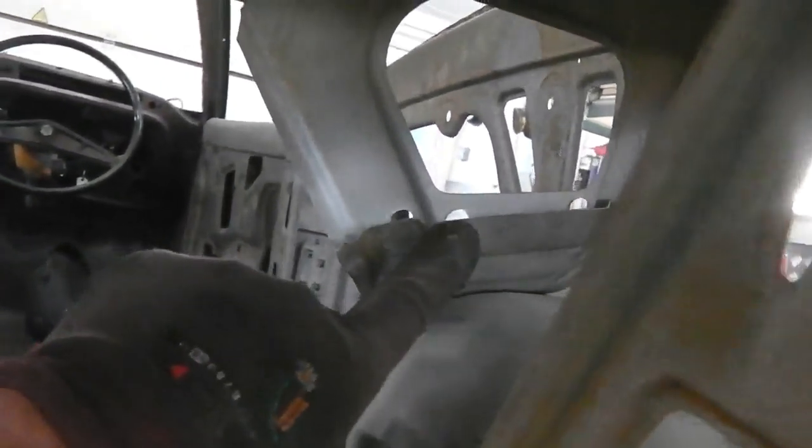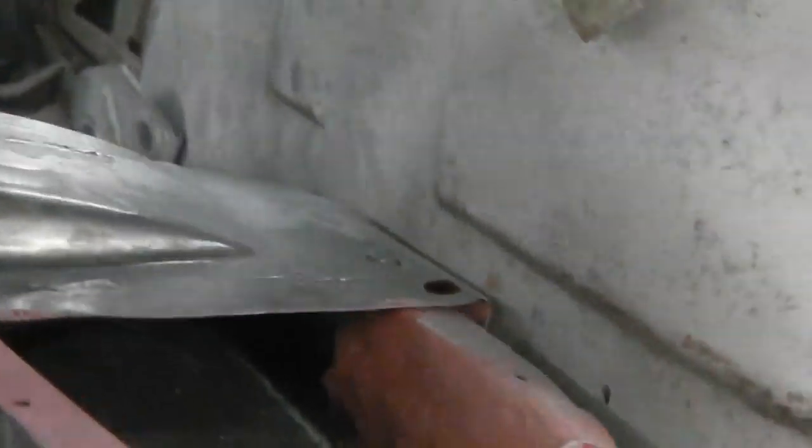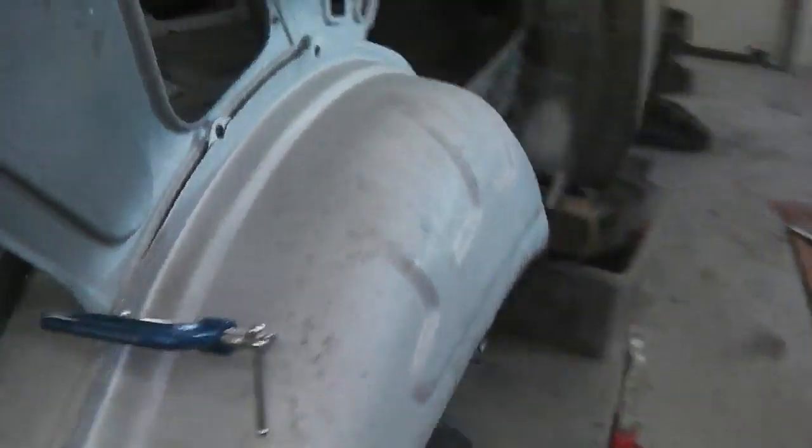Now, those spot welds are slightly over drilled. You see those holes there? This is exactly where it landed, so we'll have to just fill those up. They've got in the way. That's not a problem though, jobby grabbing again. Here, and then onto there nicely. All in all, a very good job. Almost level with the edge of there, that'll pull in all right. See there? So we're looking good there. I think we're going to go with that. And I start getting some spot welds in it.